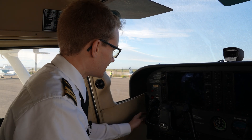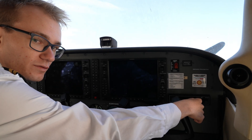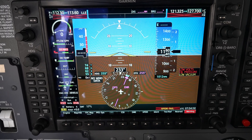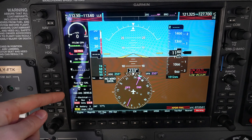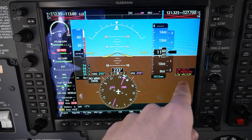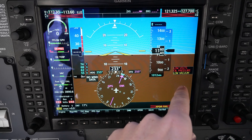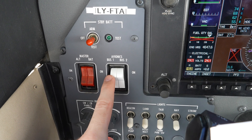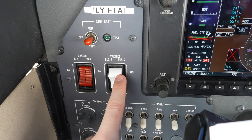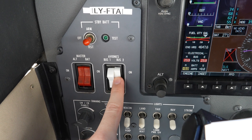We also check that the fire extinguisher between the seats is secured in place and the gauge is in the green arc. Moving on to electrics, we check that both our avionics buses are off and, if installed, that our ADF receiver is also off. Once we've done that, we can turn on the master switch. After the G1000 has powered on, we check that all our engine instruments are working and verify the fuel levels in the left and right tank, making sure there is no low fuel annunciator shown. We do want the low volts, oil pressure, and low vacuum warnings visible. We then turn on the avionics switch for bus one, checking that we can hear the forward avionics fan, then turn it off again. We do the same for bus two, verifying that the aft avionics fan starts to spin, then turn it off again.